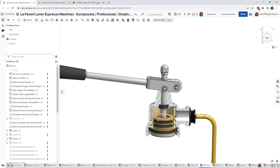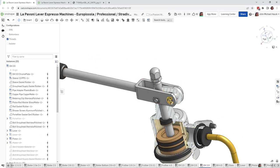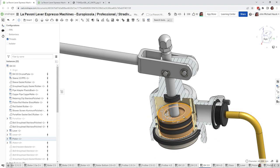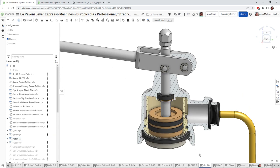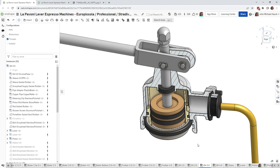and then you can tighten the piston shaft into the piston. You may want to maybe put that pin in, maybe unhook the whole lever from this side as well, and that way you can keep this shaft from turning as you grab, maybe with a towel or a rag, and grab the piston and tighten it. Maybe you want to take it all the way apart, put some Loctite on there or some other thread locker to try to keep it from coming undone again. I'll leave that up to you as to what kind of thread locker. Maybe you just want to use some Teflon tape.